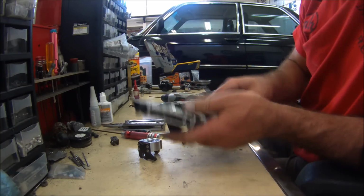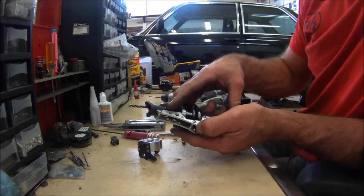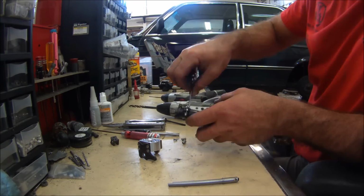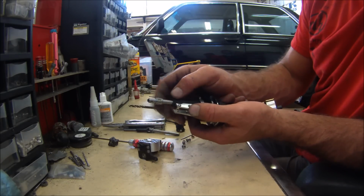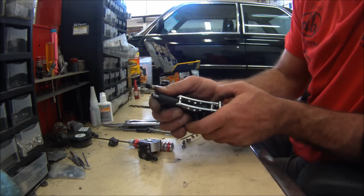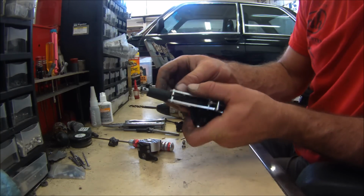Okay, so if you're doing the rear end now, all you got to do is attach your ring gear to the locker that I give you, drill it out like I just showed you how, and then the rear end is only going to be different in that it has a lockout. So you just put the shaft in after you drill it out, put this bearing on, grease this bearing. And then you're going to take your lockout and you put your lockout on. Okay, I'm not going to go in there and pound the shaft in again, but put this on and then same thing, right?